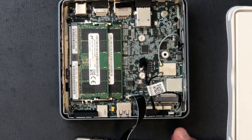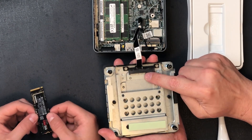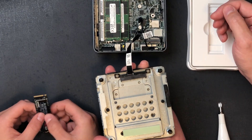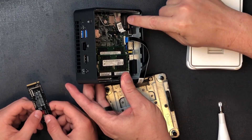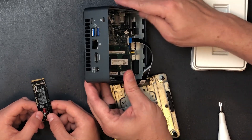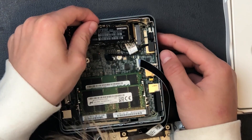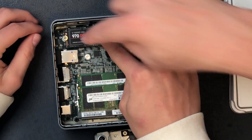Now we've got to put in the hard drive. This ribbon cable comes up and goes into what is the hard drive slot — this is for a normal hard drive right here. We could even expand storage by buying a 2.5-inch hard drive that has much more storage space; it would be slower but would have much more capacity. But we're going to install the NVMe drive — that's this socket right here. It actually looks like there may be two sockets, so you could have two NVMe drives installed. We're going to install it — get the gold parts down inside, there's a little slot it fits into, and you just push it back and in.